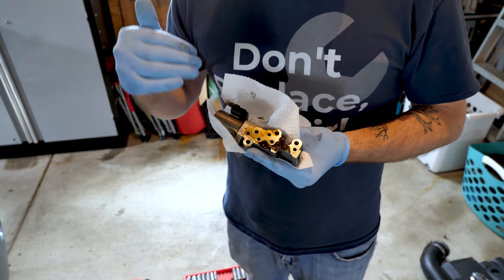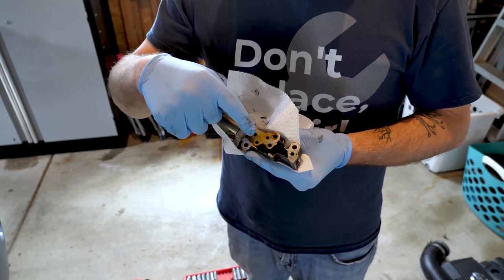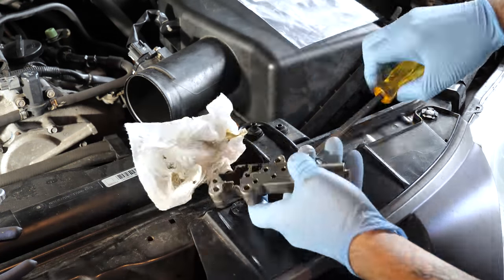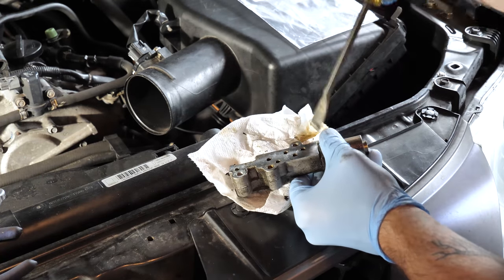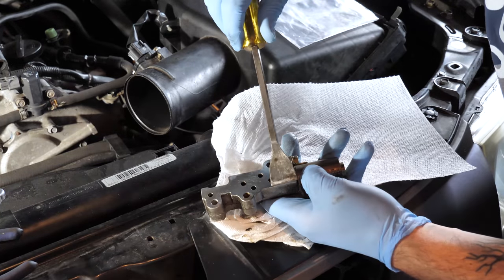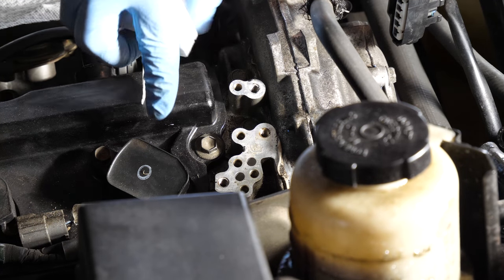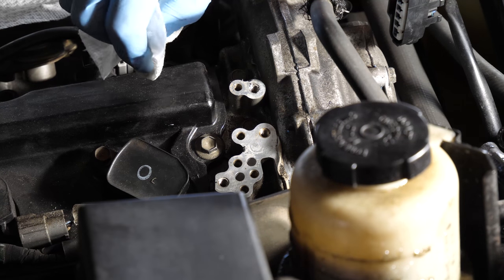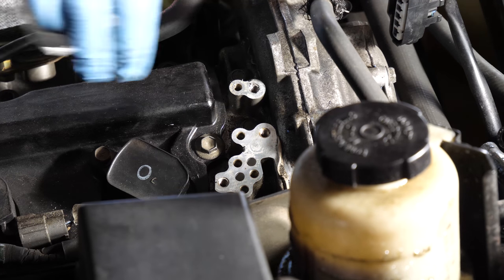Here's the valve — I'm actually going to reuse it, so if you plan on reusing yours you'll need to clean it as well. If not, just toss it and grab your new one. Use a gasket scraper and make sure it's nice and clean all the way around. Be very careful not to get any remnant gasket material into the oil holes. The same cleaning needs to be done on the mating surface where the valve goes back onto the motor. Since the intake manifold is off, go ahead and clean all of that area — it's a good opportunity when you have access to something you don't normally have access to.